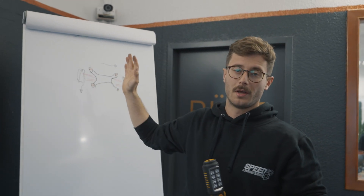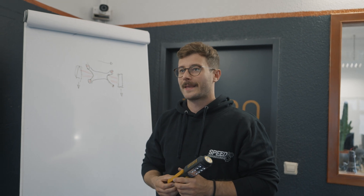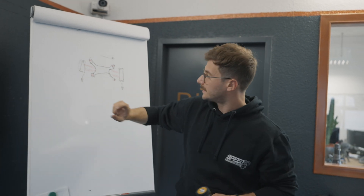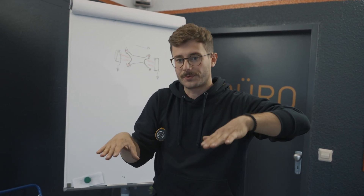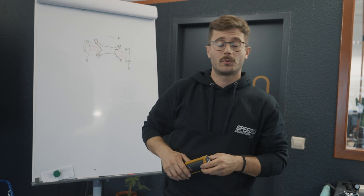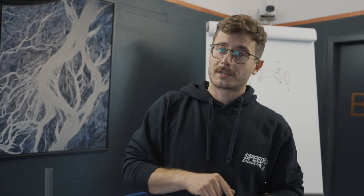The relative movement was gone, but why did I still change the suspension? Because now I really felt what the suspension was doing, and I felt it was not doing a proper job according to the grip level of the tires we have now. The second point is these bushings are a little bit shorter, which means the rear sits higher - so the car was lowered on the front and higher on the rear, which automatically means it wasn't well balanced and the tail was a little bit too light.